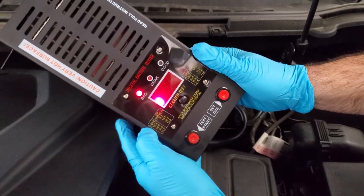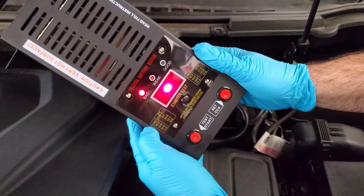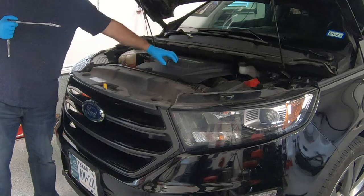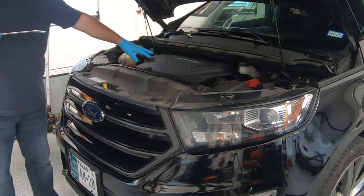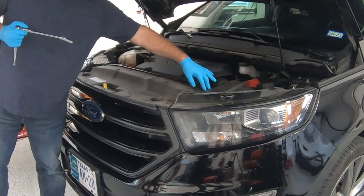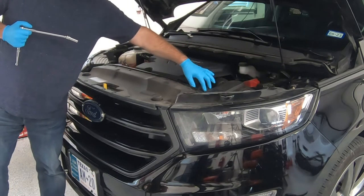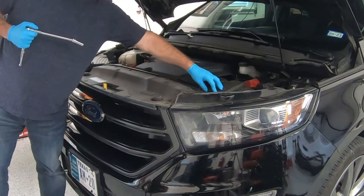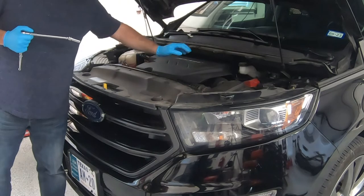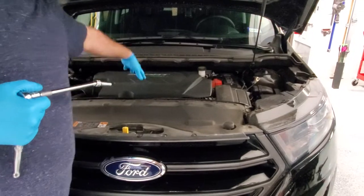We're showing bad now. The battery failed the test and is obviously bad. The first thing I'm going to do is take the engine cover off. This may not be a necessity, but I believe it will make it easier to access the intake boots over on the air filter housing. We're going to have to take the top off the air filter housing anyway, so I think this would just free up access. The bolts up here on top of the engine cover are a 10 millimeter, so we'll go ahead and get those removed.